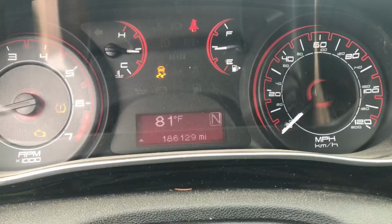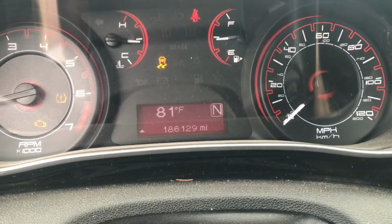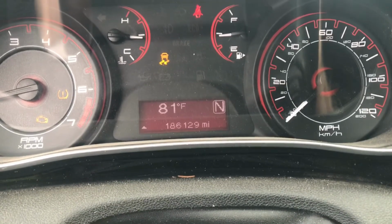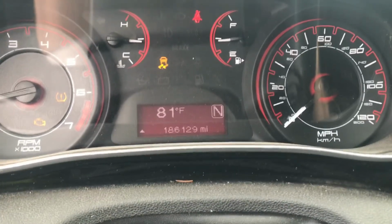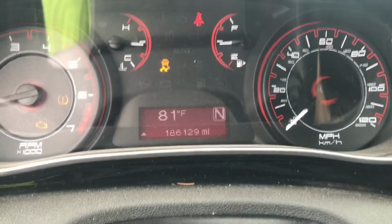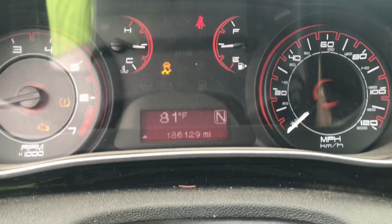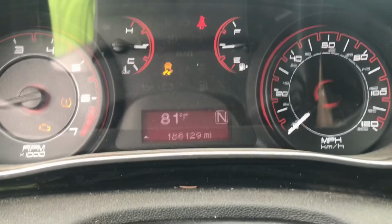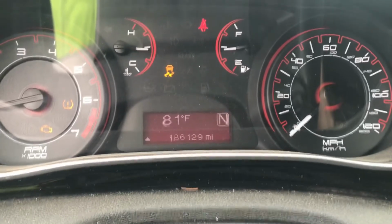Real easy job, really. I'd give it probably about a 4 out of 10 rating of hardness, 1 being easiest. The only reason I go that high is because that 32 mil axle nut without an impact could be kind of a nightmare, but you know, you could do it. Pretty easy though, simple basic hand tools. That 8mm ball Allen is pretty handy, but you could probably get it with a regular right angle Allen wrench, just a little slower. That's just what I found the best.